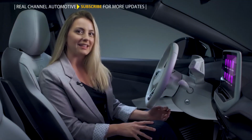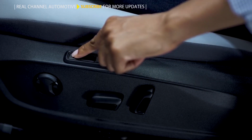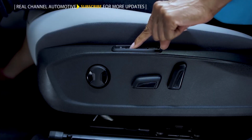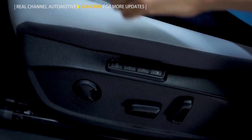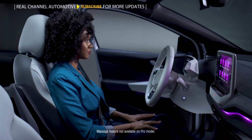To enter the memory seat setting with the vehicle in park, press the Set button for 1 second until it illuminates, then press and hold the desired memory button until you hear a chime. If the seat position has changed with the door open, press the desired memory button and the seat and mirrors will move to the set position.